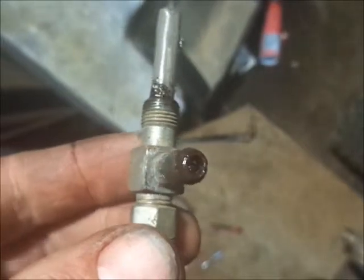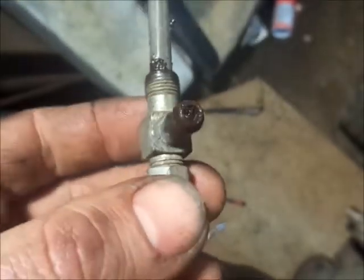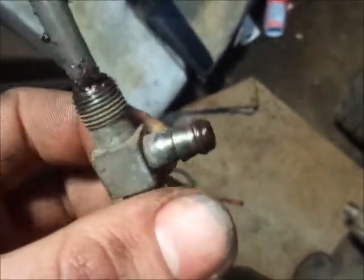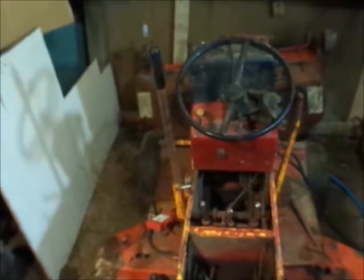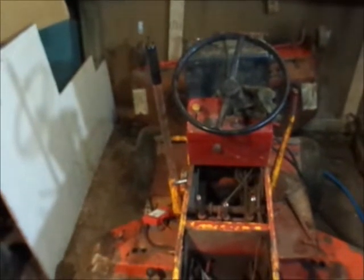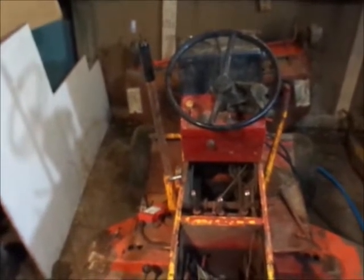So the petcock out of the 430, and I wondered why nothing would go through it. Yep. Well, I'll have to clean that out. And I'm going to drain the fuel out of the tank because it smells like 10-year-old fuel, and it's probably about 6 years old, I bet. It's been sitting in that tank garage in this tank for however long. It makes me wonder about the case and the 129, although I have had them running since then.